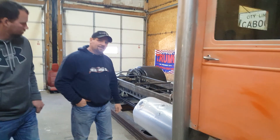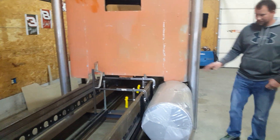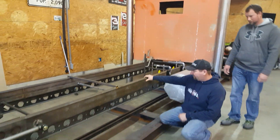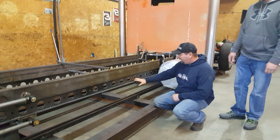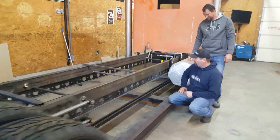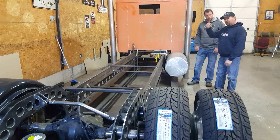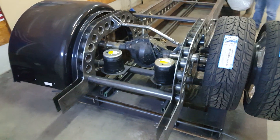Is it going to rain soot? I hope — it's going to blow smoke. That's my plan. So tell us about the frame. It's two-by-six rectangle tubing. I went to D&D Fab and he water-jetted me what I call a bridge for the bottom — it's quarter-inch — and we did three-inch holes with three-quarter-inch holes. My plan is to do lights in every one of the small three-quarter-inch holes so it'll light up down the road. I went to the marketplace and bought fuel tanks — they're 36-gallon tanks and there'll be two of them on each side.